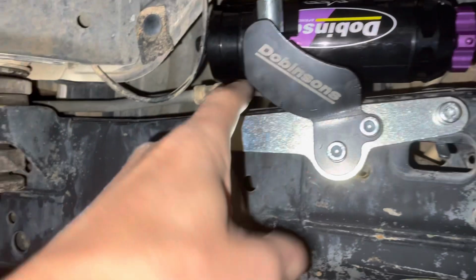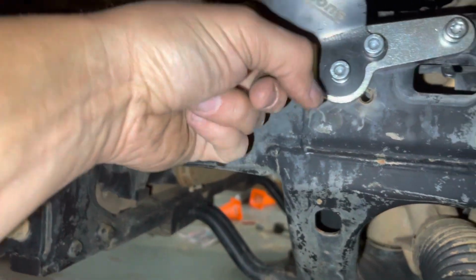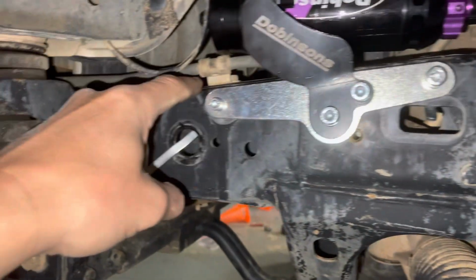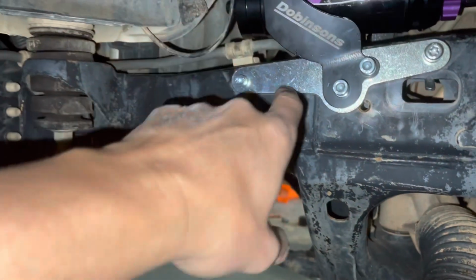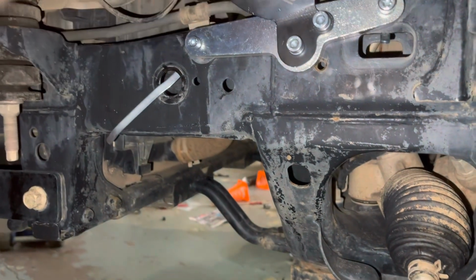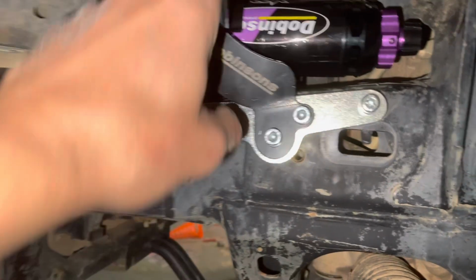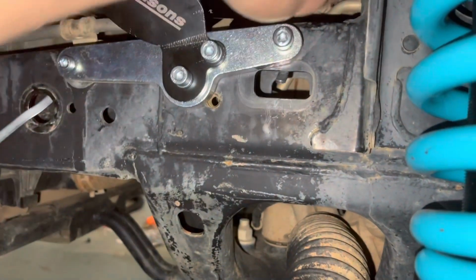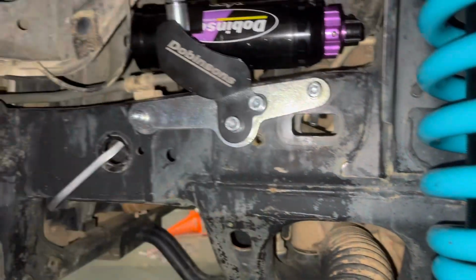You're going to have to put this on the driver's side because of the earth. There's an earth point right underneath here, and then you have one of your power steering lines that runs along the frame here. So if you just bend it back in the vise, you can now tighten it down and still get to everything, and it remains all out of the way.